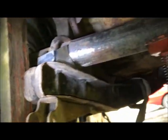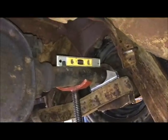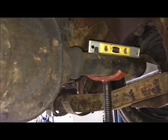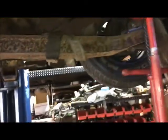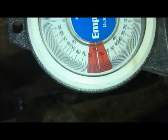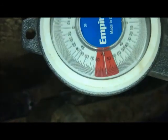All right, so fine. Time to install this rear. No more screwing around, changing rear axles. It's located with the trailing arms, just to keep it where it's going to be. And on the stands, obviously, holding it up, I have my pinion set to 3 degrees up. That baby is at 3 degrees.